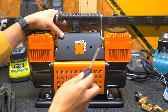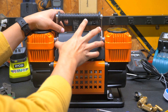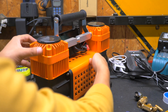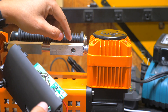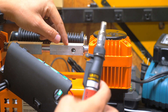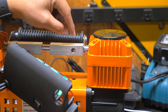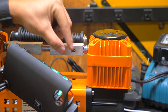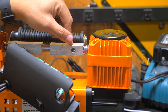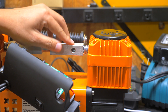The first thing you want to do is get a screwdriver and undo all the screws on the front and back, and remove the plastic cover. On the backside, what you're going to want to do is use a lighter or a torch and heat up this section. There's some thread lock that makes this little piece really hard to remove. Once it's heated up, get some pliers and slowly unthread it — it comes out pretty easily.